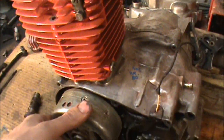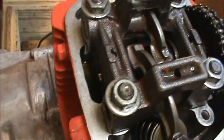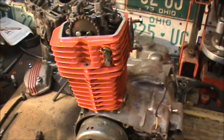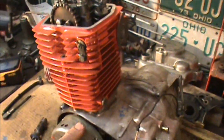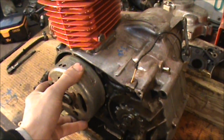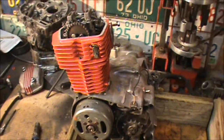I've also heard a trick: if you pull your spark plug out, get a light and look in there at the piston to verify that it's up. And when you are at top dead center, you should be able to wiggle the crank just a little bit like this, and you see that piston won't move at all. That's also a good indication.